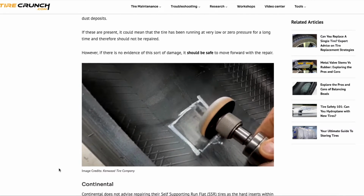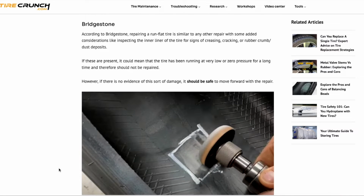And one thing about the NX in particular, it has these run-flats. It's an all-wheel drive vehicle. So say you got 1,000 miles on these, and you got a screw or nail in one of them, and it's repairable. Yeah, if it's repairable, you can do that. But if you can't, you can't just replace one. You got to replace all 4 tires.